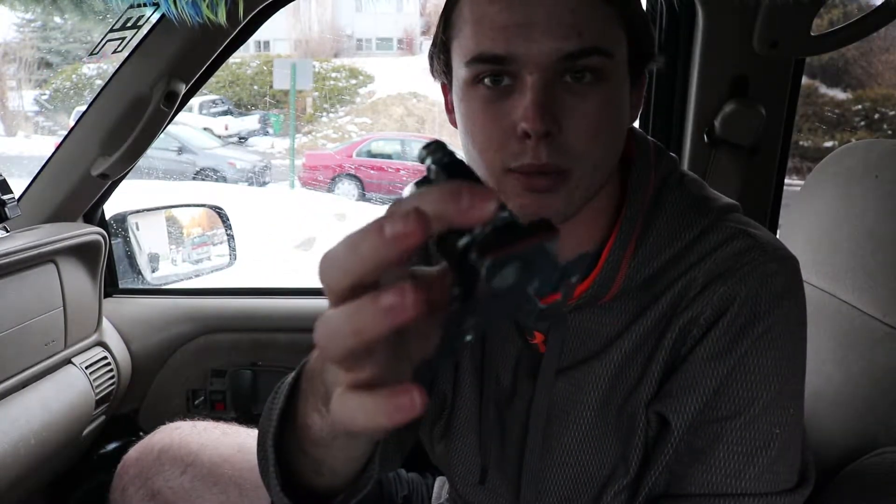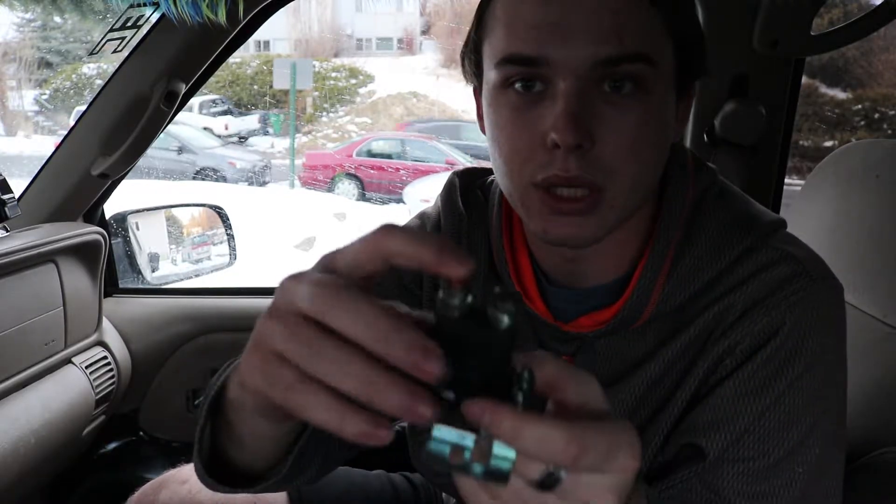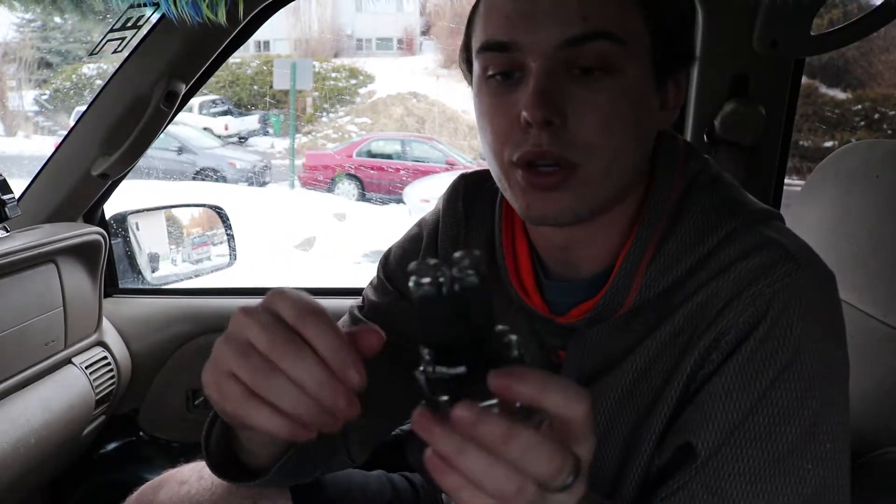Hello everyone and welcome back to the XSP Green Monster Channel. Today I am going to be replacing my Pack 80. A Pack 80 is an 80 amp battery isolator — basically a relay rated for 80 amps. You get a power that goes to one terminal and a power that goes to the other, plus a ground and a turn-on. I have my turn-on down here on these switches, which controls my alternators.